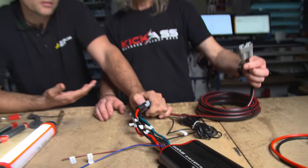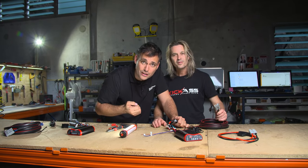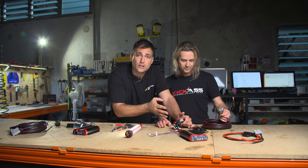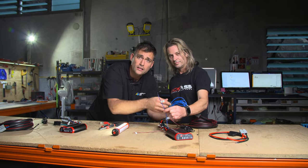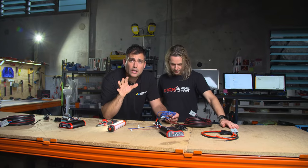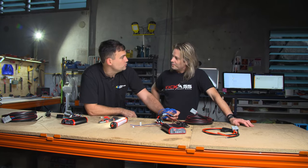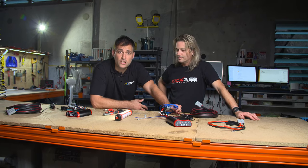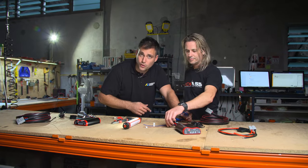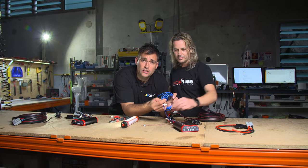But if you did need to run an ignition wire for a plug-and-play setup — like battery boxes — you'd have to get a wire, run it to your vehicle, and hardwire it in. Now, when I say ignition, let me be clear. In your car you've got off, ignition, and then on. When you're on ignition, the car stereo turns on. So ignition isn't going to work — we call it the ignition wire but we should probably call it the on wire. When the engine's running, this sends a signal to the DC-DC charger to start charging.